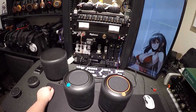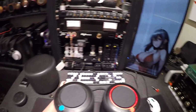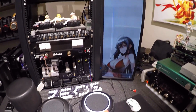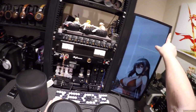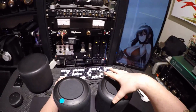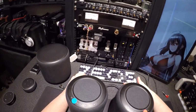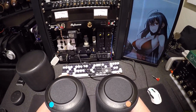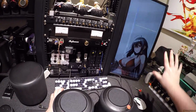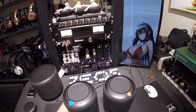Okay, I'm going to mute you again. So, the microphones work except when you're hammering them. And what I mean by hammering them is here. I'll unmute them again. We'll put this up to maximum. And by the way, I want to point out the digital signal is cropped 4 decibels. Make it 5 decibels, 5 dB. Because I could tell that when you give it a Wi-Fi signal, it perfectly knows how to adjust for that. When you give it an external signal, either from 3.5 millimeter analog or optical, you're in charge of the volume, and this is not prepared for that. So you have to make sure your volumes are all good. But now, I'm going to try to ask it Phoenix, Arizona's weather right now.